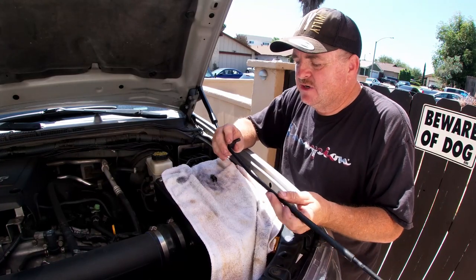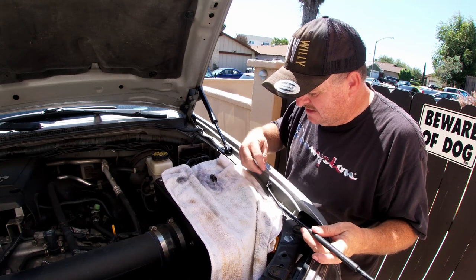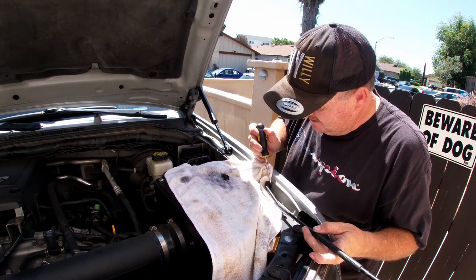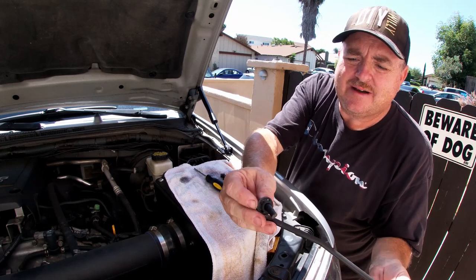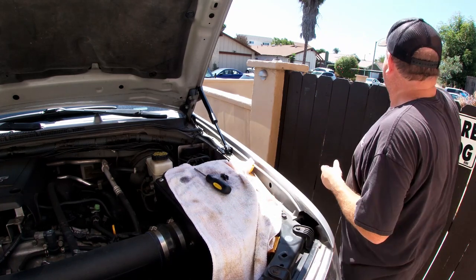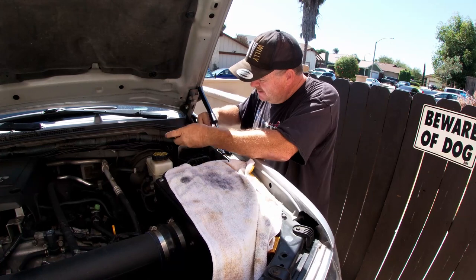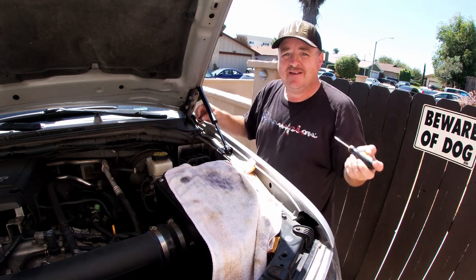After I got the install done, I went ahead and took the hood prop rod out. The prop rod is held in by a little grommet or plastic clip. I took my screwdriver, put a towel there to protect the paint, and just kind of pried it until it popped out, then rolled it out. It's got four little clips that hold down to the fender and that removes it. The holder for its storage point also has a little clip — I pushed the clips in on the bottom and it popped right out without any damage.